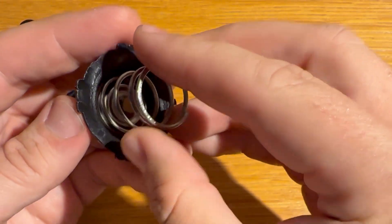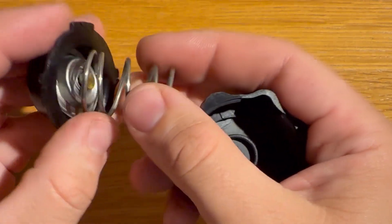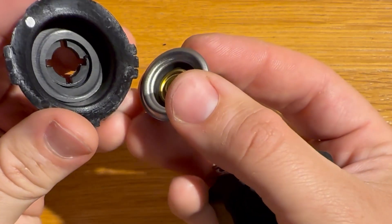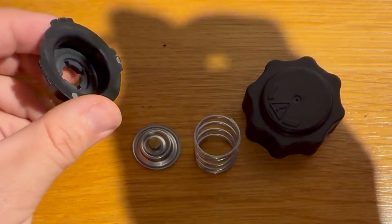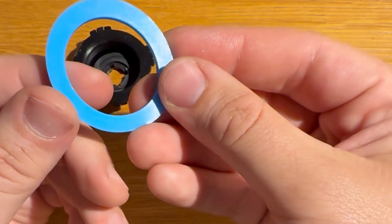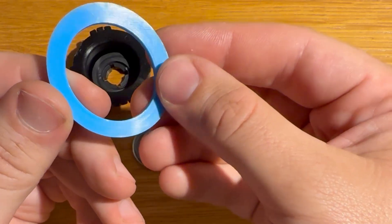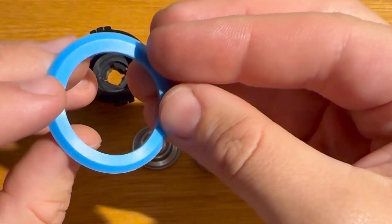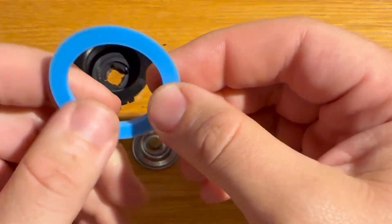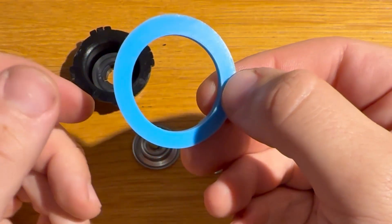The spring is all set, and everything clips together. It's also worth noting it took a lot of force to unclip the cap — the others came apart fairly easily, but the Febi cap was not for disintegrating involuntarily, which is good. As you can see by the light ring on it, this cap sits with the larger portion of the seal against the rim of the expansion tank, giving it a lot of area to seal. It's also a really nice, soft rubber. That is definitely the nicest seal out of the four. Impressive.